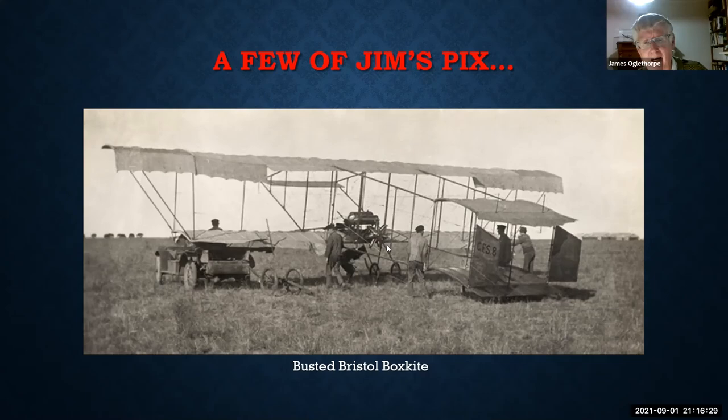Now, as engines improved in power after World War One, basically the rotary engine became obsolete, and the similar radial engine, where all the engine is fixed and only the crankshaft rotates, was then current right up to the advent of jet engines. We had some very powerful radial engines, like the Qantas Constellation aircraft, that sort of thing, had really sophisticated radial engines, whereas the rotaries more or less died at the end of World War One. That was the end of them.